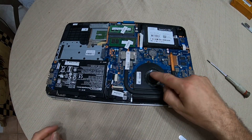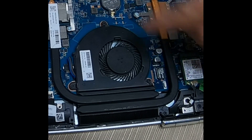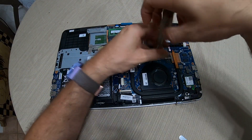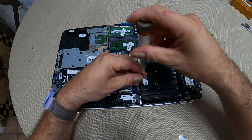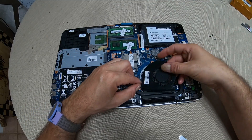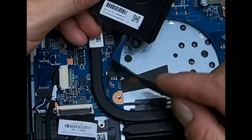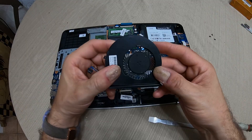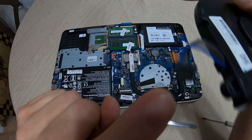I'm going to turn the laptop around so the cooling fan is on this side. There is the electrical connection right here, and there are three screws holding this in. I take out each screw and set them aside. Then I lift the fan up, slowly bring back the connector, and pop it out. Here's the backside and here's the electrical connection.